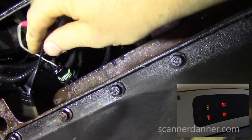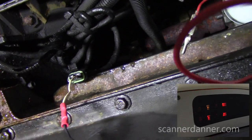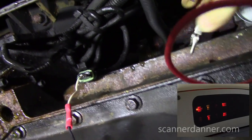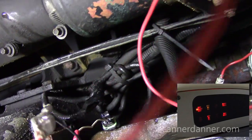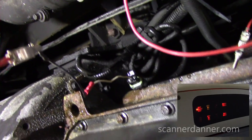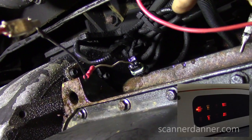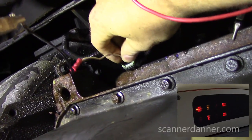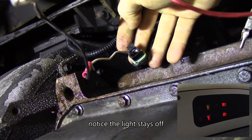Touching the wire to the block — I got lucky, it was the first one, the wire on the right. I'll show jumping the other side too just to confirm. Now I'm on the left terminal. So we've answered a lot of questions: number one, we know this switch is for an overheat light. Number two, the manufacturer used a 215-degree temperature switch.